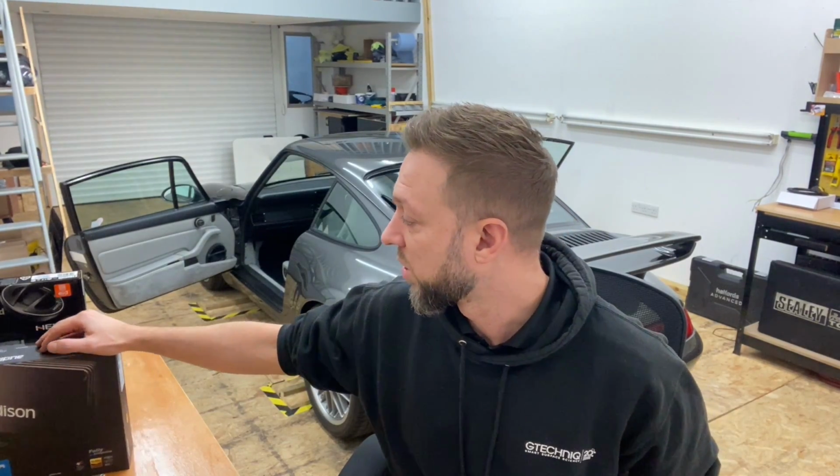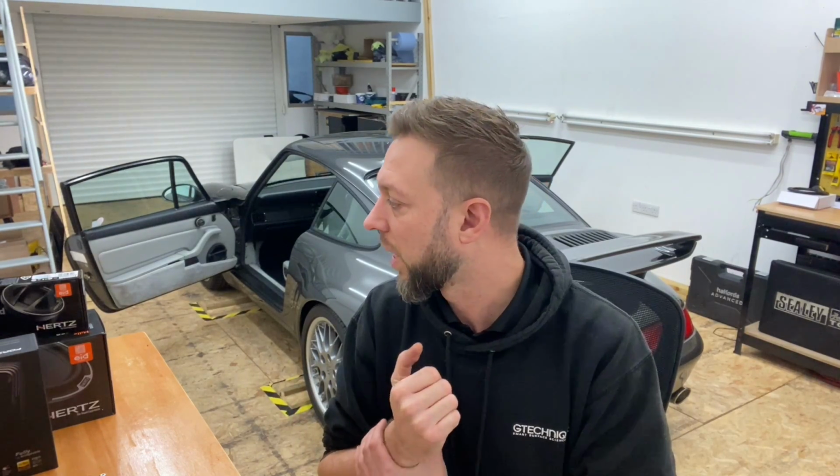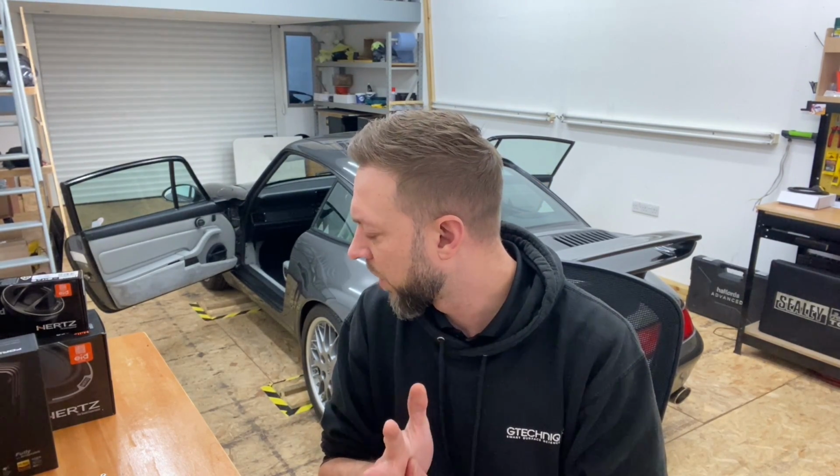So we've bridged the woofer channels to give those, I think it's about 280 watts, which the Mille Legends will more than take. In fact, I've turned the gain down on those a little bit just to balance it out, otherwise they'd massively overpower the system. But it's nice being able to give those a lot of power so they punch nice and hard. Where was I?